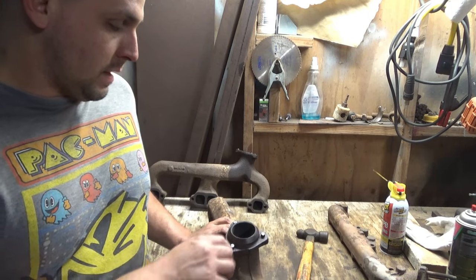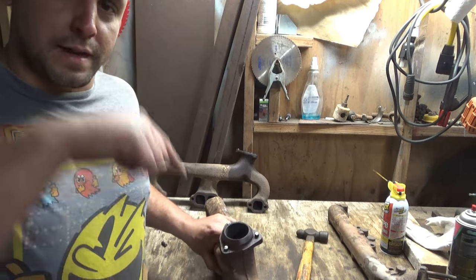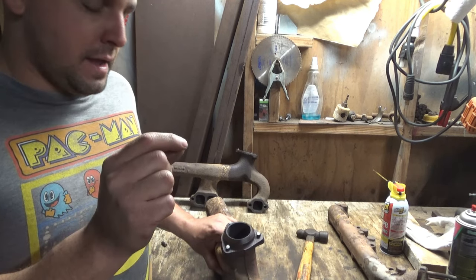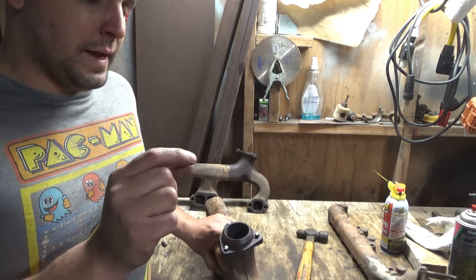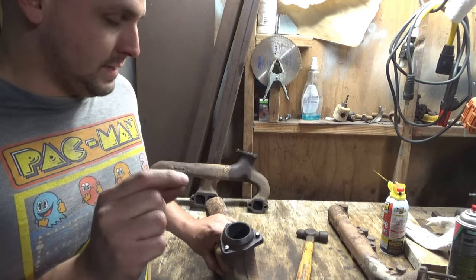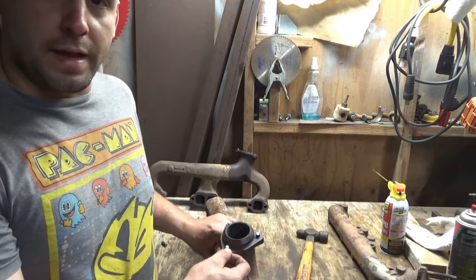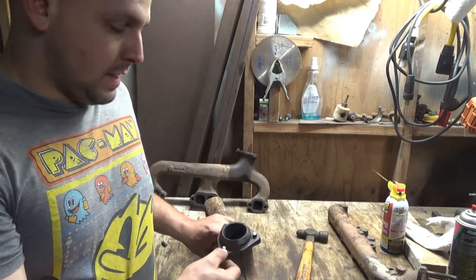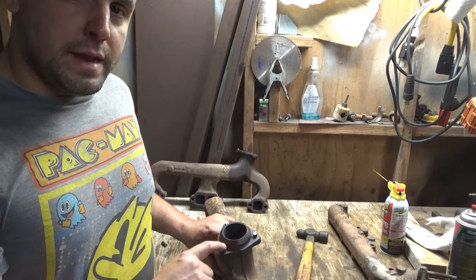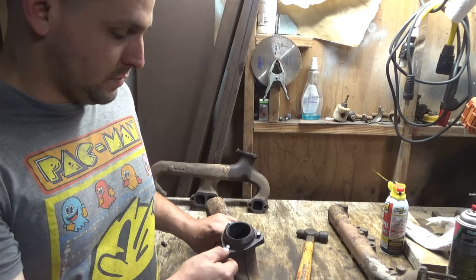The only thing you could do is heat it. And even if you have the correct extractor — the ones that go inside that you drill out the center — I'd say that if you put the biggest hole possible in it, that might loosen it up. I'm not sure if that's true, but it seems like it and it'd be more likely to get that out. The only problem is a lot of bolts are hardened and you can't really drill them. Well, these are cheap exhaust bolts — they're probably not hardened that much. I'll show what it looks like when you try to drill holes in this with a cheap drill bit.